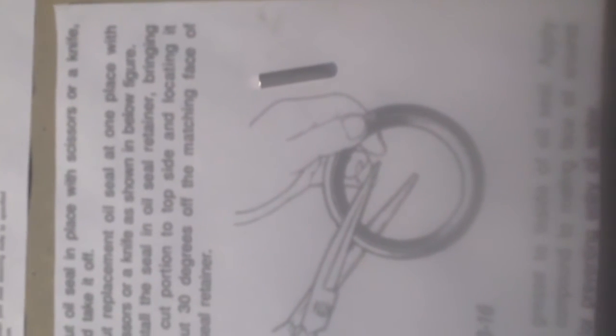It took me less than an hour. I didn't even jack the vehicle up. I just got under it, unbolted it, and took the felts out. There was no rubber seal there. It was gone completely. So I cleaned everything in there, scraped it with a scraper, greased that ball in there, and put the seal in. Doing it by myself, it would have been a help to have a helper, because I had all those bolts and all those little metal rings and the seal to get back into place. But it wasn't that hard.